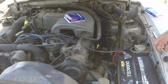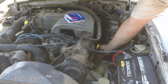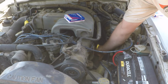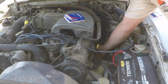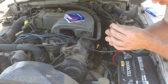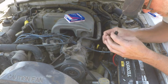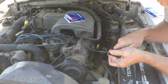And I think in this case it's O2 sensors are down there. So what you would see is it averages the exhaust gases of a whole bank together. So if you're getting rich and lean on one bank, as readable on the plugs, it's about the same. This one's barely used, barely fired. Maybe a little, yeah. Anyways.